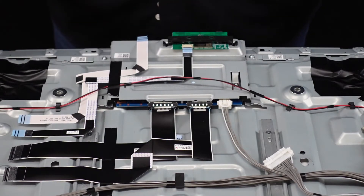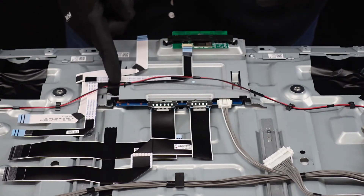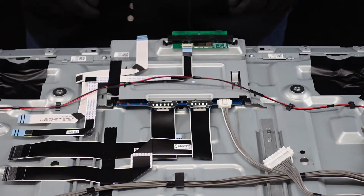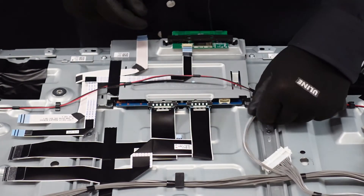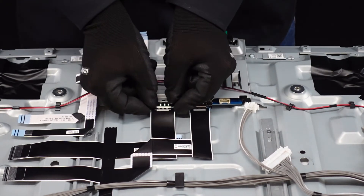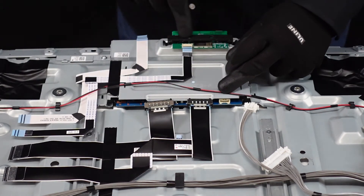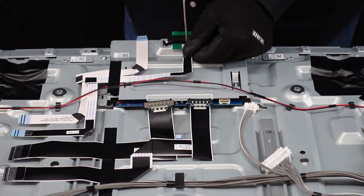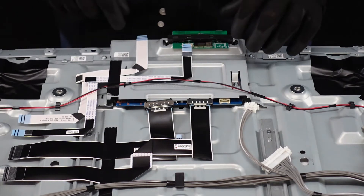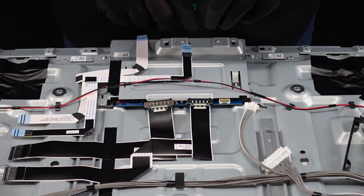Moving on to the T-Con. There is a bit more involved with this one — there is a metal plate over the top. Let's go ahead and get these cables removed as well as this strip of tape, and we'll work on this Wi-Fi board as well. For this connector, just press down in the middle to release that lever and pull it directly out. Pinch it and pull it directly out. These LVDS cables we're just going to pinch on the sides and shimmy out. Now at this point we can go ahead and disconnect this connector — there's a metal tab holding it in place; use a screwdriver to pull back on that. Press down to release it and pull that directly out. Then pinch in on the sides of this connector, and that Wi-Fi chip can now be removed.